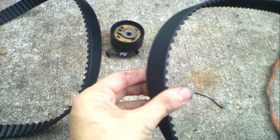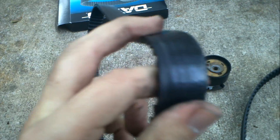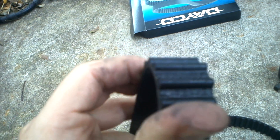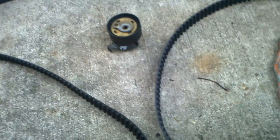I hope that was a good comparison between a used belt and a new belt, so you can get an idea of how to tell if your belt needs to be replaced. Just like I said: look for cracks on the outside, and if you have the belt off, look on the inside to see if it's starting to shred apart. Thanks for watching, guys — take care.